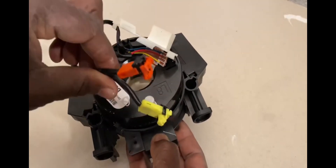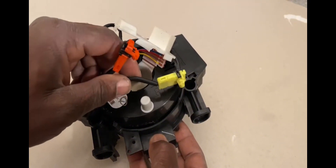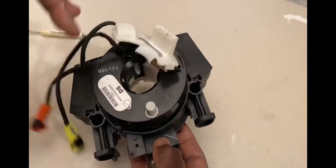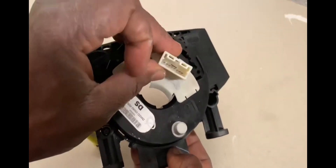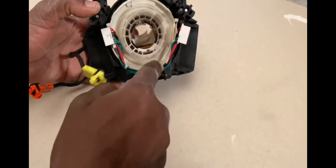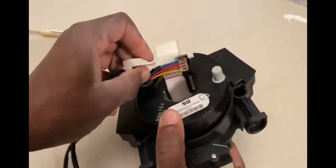They put something like a video cassette tape — a wire that can permit the steering column to turn left and right without disturbing the continuity of those wires. Here you can see the two stages of the airbag: the airbag module on the steering column — one is for deployment and the other is for the second deployment. All these pins are the same pins that come through here and go inside the wire connector around here, then go outside.